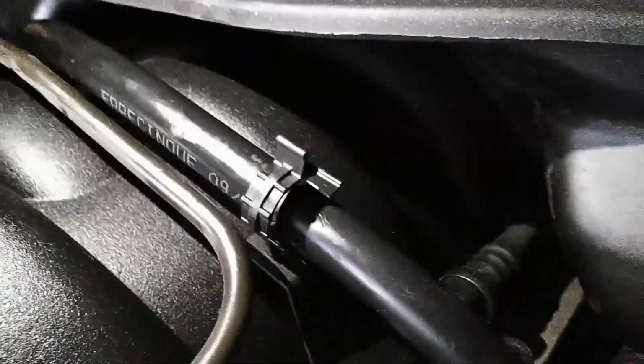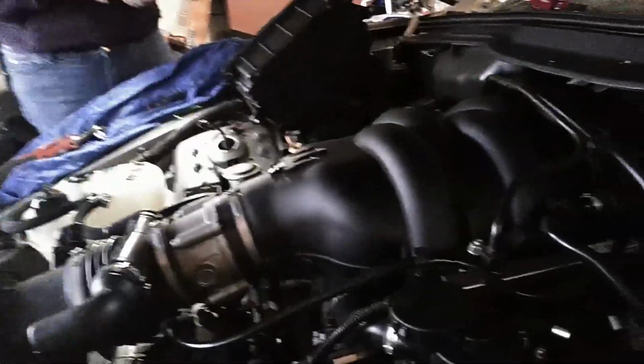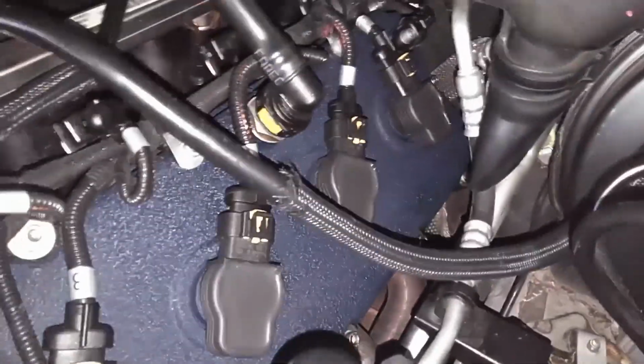We got all the valve cover screws in and tight. I'm starting to think these spacers that are on the screw going through the cover actually bottom out when you torque that cover down to 10 newton meters, and it'll create a good seal for your gasket. I got them all tight all the way around. I got the cam sensor in.